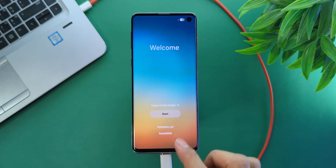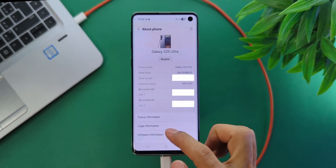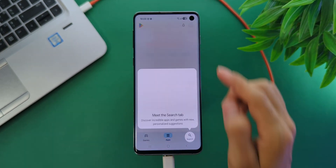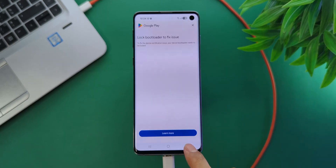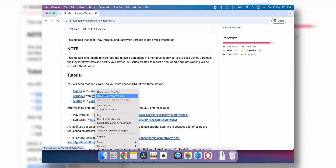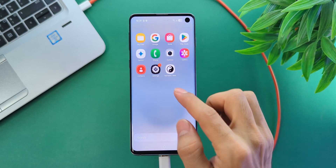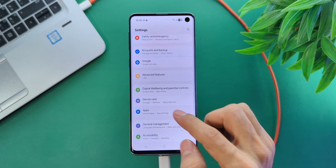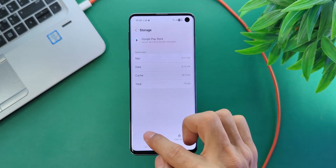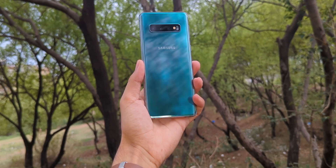In a few minutes you will see the One UI 7 home screen. Go through the setup steps, skip what you don't need. After that, check the model — it'll show you you're using the Galaxy S25 Ultra. Sign in with your Google account and start checking out the new features. One thing to note though: when you go to the Play Store, it'll probably say 'device not verified' — that's normal on custom ROMs. To fix it, download Play Integrity Fix and Zygisk from the links in the description. You'll flash them using the KernelSU Next tab. Move the files to your phone, open KernelSU Next, go to Modules, Install, and select both files one by one. After that, go to Settings, Apps, and clear storage data for Google Play Store and Google Play Services. Then reboot the phone. Once it's back on, go back to Play Store, check the status, and now it'll say 'device is verified.' That's pretty much it — if you decide to install this and test it out, please share your experience in the comments.